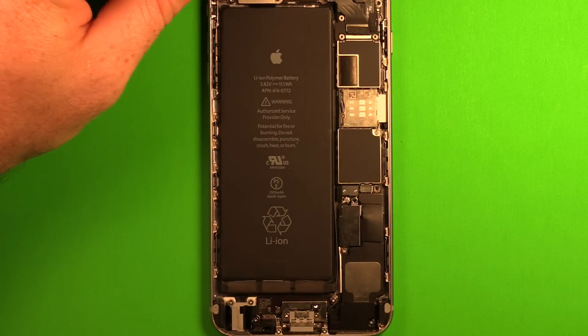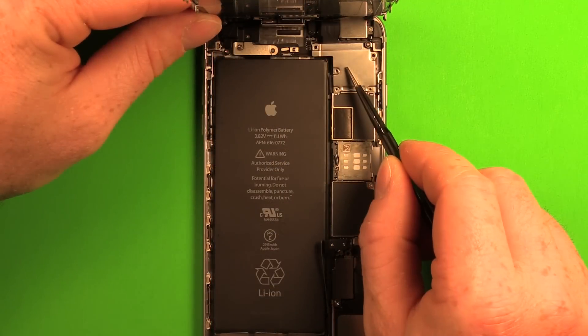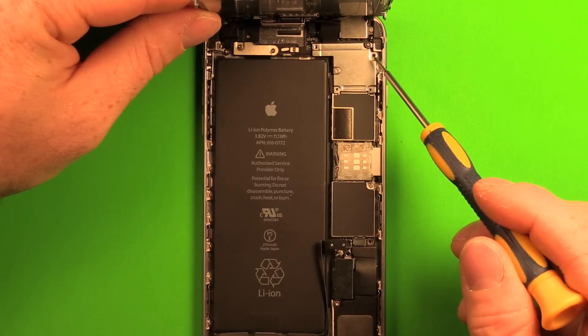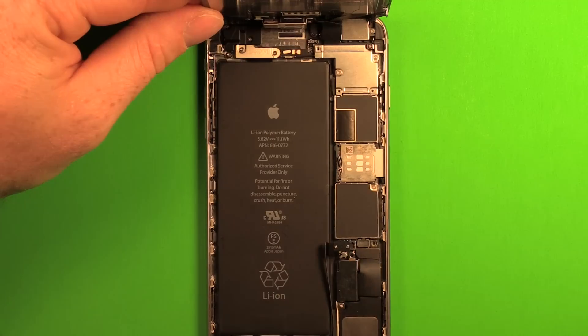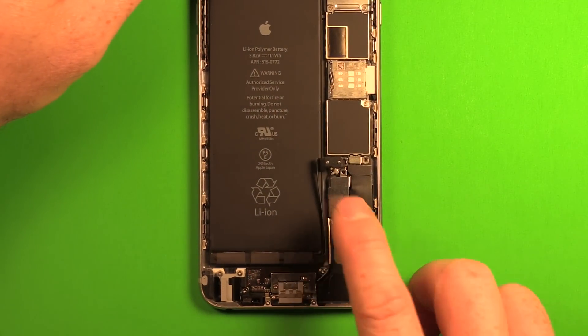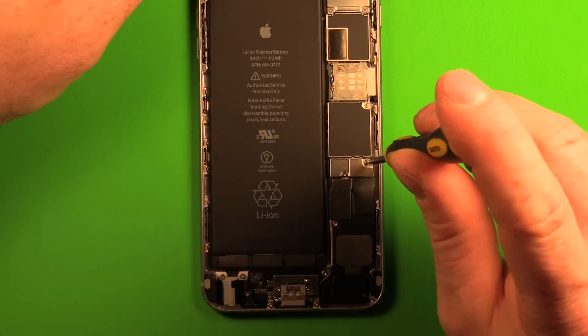Once the phone is powering down, open it up — make sure not to put the screen up more than 90 degrees. Disconnect the battery again to get it out of the way while you set the connector plate in place and fasten the screws. You can use the magnetized screwdriver or tweezers to set the screws in the holes. Don't over-tighten — just snug. Then reconnect the battery, grab the battery plate, set it in, and tighten those screws down.